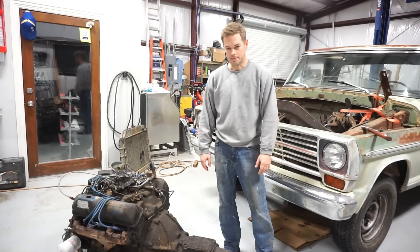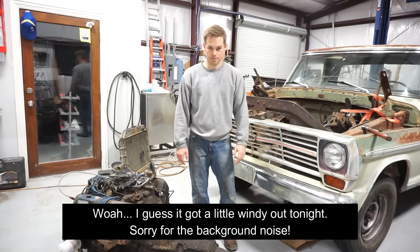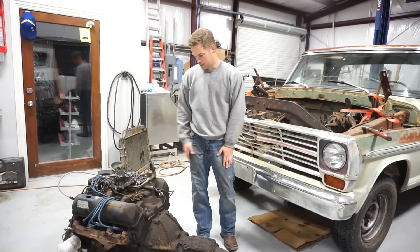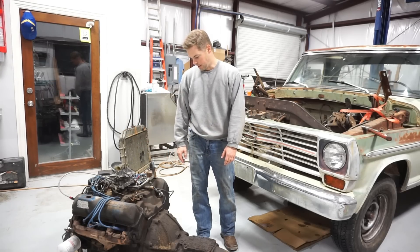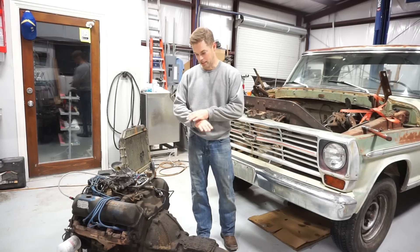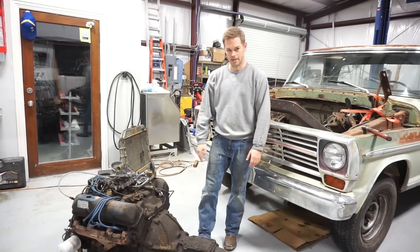Well, that's it — it comes out almost as one unit. I did forget to disconnect the starter wire from the starter solenoid, so I had to stop and do that. Other than that, everything was disconnected. I took the crossbar out from underneath the transmission, and as soon as the jack took the pressure off it, folded it out of the way. Set it on the ground — engine and trans come out as one piece, nice and easy. You can have the carburetor and all your accessories on, minus the power steering and alternator, and take it right out. No need to pull the intake manifold, pull heads off — just leave it all together and take it out. Same thing going back in: put the engine almost all the way back together, starters on, headers on, manifolds on, transmission and clutch all together, and it just drops right back down the hole.